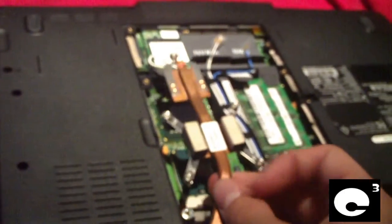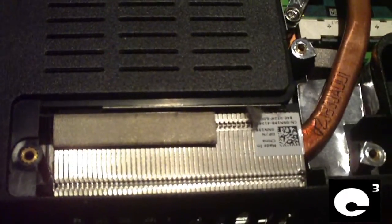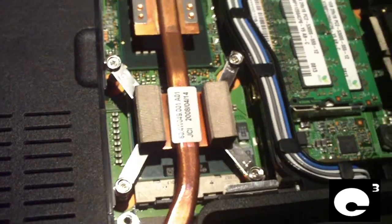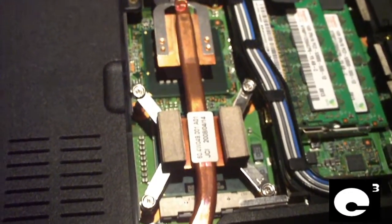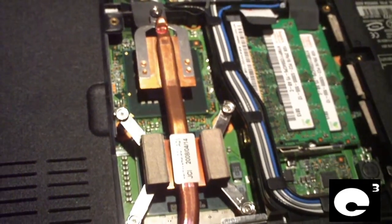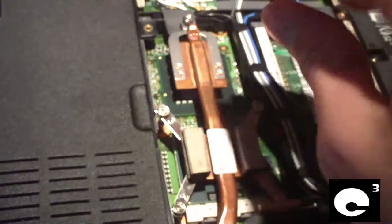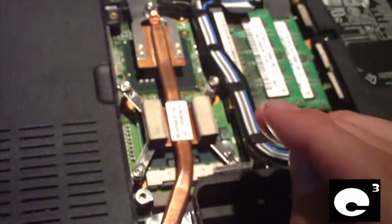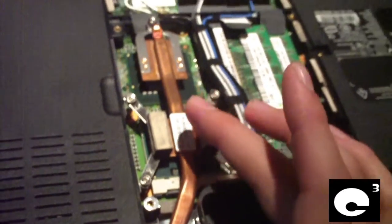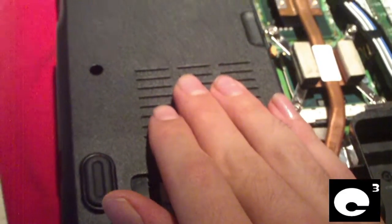When it comes to cooling systems and HPs, you have two main issues. First, like I was saying, you have the issue with fans getting clogged up with dust, and how HP's design makes that easy. There's another more serious issue with some HP model laptops, especially in the DV series — and this is a known flaw with a lot of computers with NVIDIA graphics on board. In the DV6000 laptops with NVIDIA graphics, the CPU is in the back more or less, and then you have your Northbridge, so the heat coming off the CPU goes across the Northbridge. The NVIDIA Northbridge gets really hot, you're getting all this heat going into the fan, and the fan is set so it doesn't come on that often — that's another flaw.